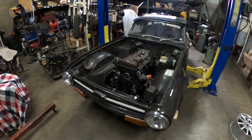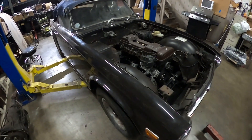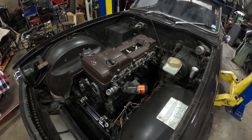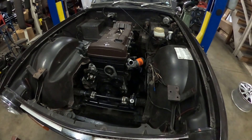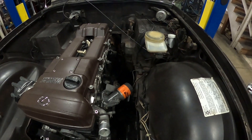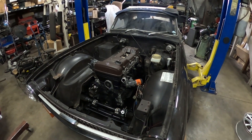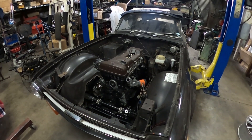The motor is finally inside and bolted on — this is how it looks. I have a couple of options for the exhaust; I can't fit the headers without shaving too much sheet metal so I'll go with a different exhaust option. For the intake I need to do a custom one because the original doesn't fit — I'd have to remove the booster and shave too much metal. The oil filter relocation kit is already in hand and I'll install that. The only remaining shaving is a small bit of sheet metal for the clutch fork clearance when you press the pedal. That's going to be it for this video — thank you for watching, don't forget to subscribe, and as soon as I get the intake sorted I'll continue and share the process with you guys.